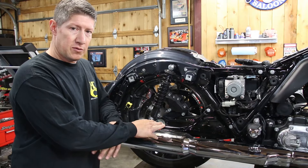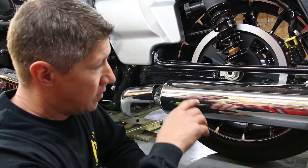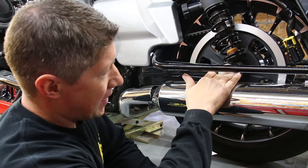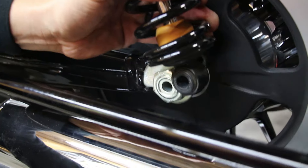I learned a trick years ago that really helped us out. So if you look right here, you take a look at that axle — getting that axle between here and here to slide it out, it's not going to happen without taking this off or this off, which can be a super pain in the butt. What we learned years ago, and this will help you get the tire on and off too, is if you take your bottom shock bolts out and just rotate the shock back like that.